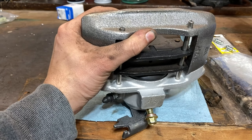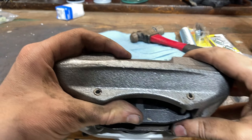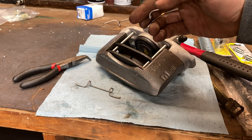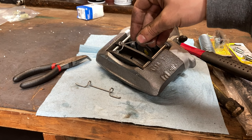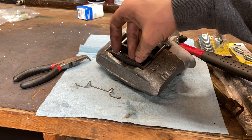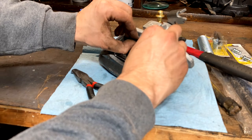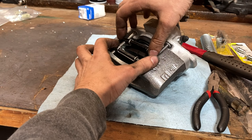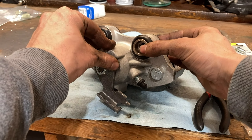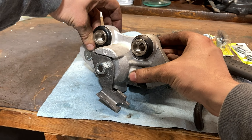It's best to use a brass punch on these to avoid damaging the pins. If you've got an old caliper and they're not sliding in very nicely, you might want to clean out these holes — try some brake cleaner and then some sandpaper or something. Next, we've got to get these tricky retainer clips in. All you really have to do is slide them underneath each side of the pins and then snap the clip over the top of the brake pad. It might be useful to use some pliers. Do both sides. Then slide each brake pad to the outsides of the brake caliper. Be sure to double check that these pins are sliding properly. If not, they might need to be rebuilt, resealed, and re-greased.